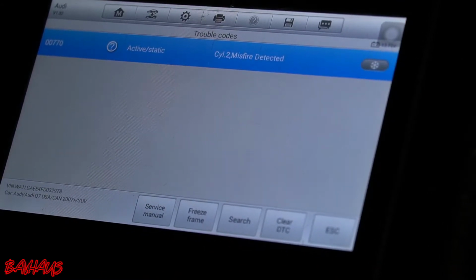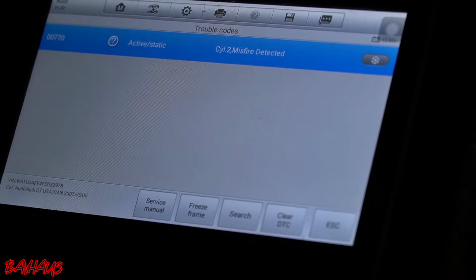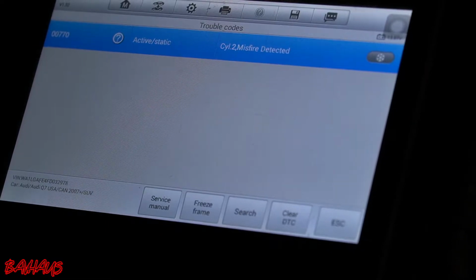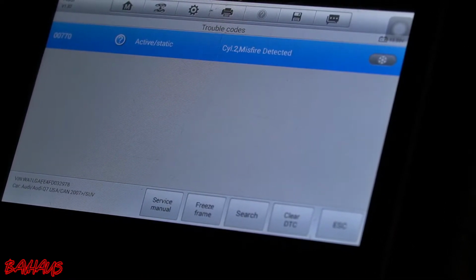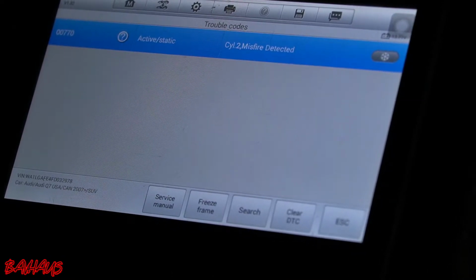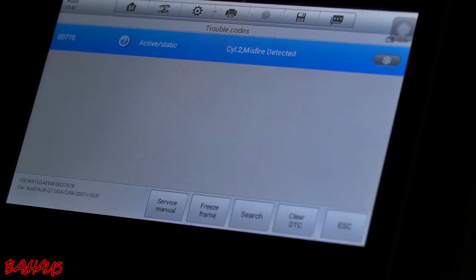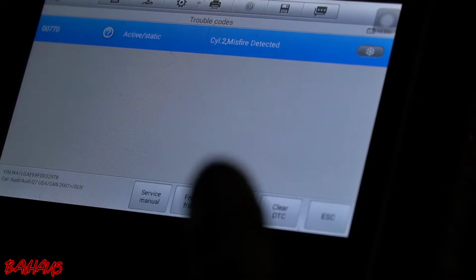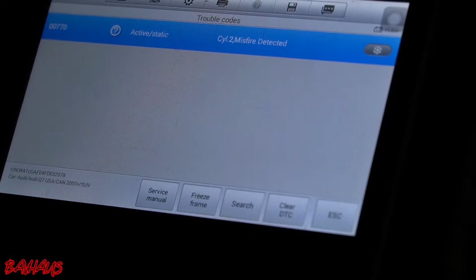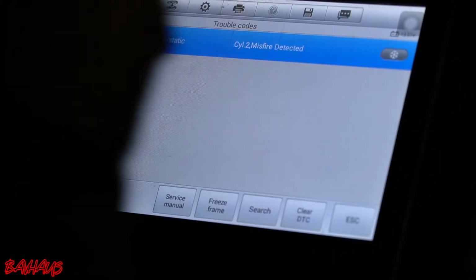And depending on if you're replacing your spark plugs or coils, never just replace the one. Spark plugs are replaced in sets. So in this car you buy 6 spark plugs, same thing with coil packs. The second you put a new coil pack in with a bunch of old ones, you're going to start blowing them like crazy. So if you have one bad coil, replace 6 coils. One bad spark plug, replace all your spark plugs. But yeah, so that's that. We're going to continue diagnosing, so stick with us.